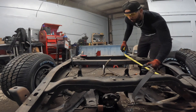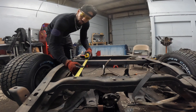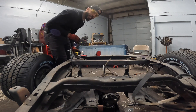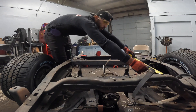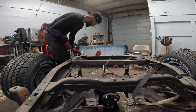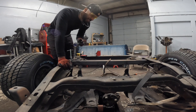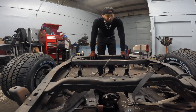Right now I'm just making sure it's square. We're at 18 and a half inches and it's square - this one's a half inch off. On the inside of the frame there's a little L-angle that I'm bumping to as a reference point. From this hole to this one - 18 and a half. I'm a sixteenth off, so I'm going to move it forward just a little bit. For right now I'm just going to tack these in place just in case I'm screwing something up - if it's only tacked, it's way easier to take apart. Trying to get a good balance without making it too heavy.